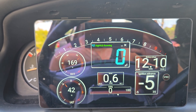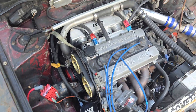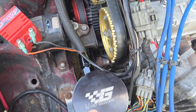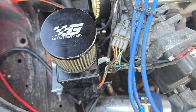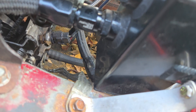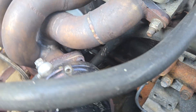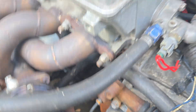That's just something I want to share. Now I know this sounds strange, but someone asked me about my catch can setup and why I have a return system. Here in this beat-up car, I have my lines for blow-by and it goes into this catch can. It doesn't just hold oil in there like most typical catch cans that lead you to having to drain the sludge, the water, the moisture. Mine actually has a drain — it drains right back into the block via the black line at the bottom.